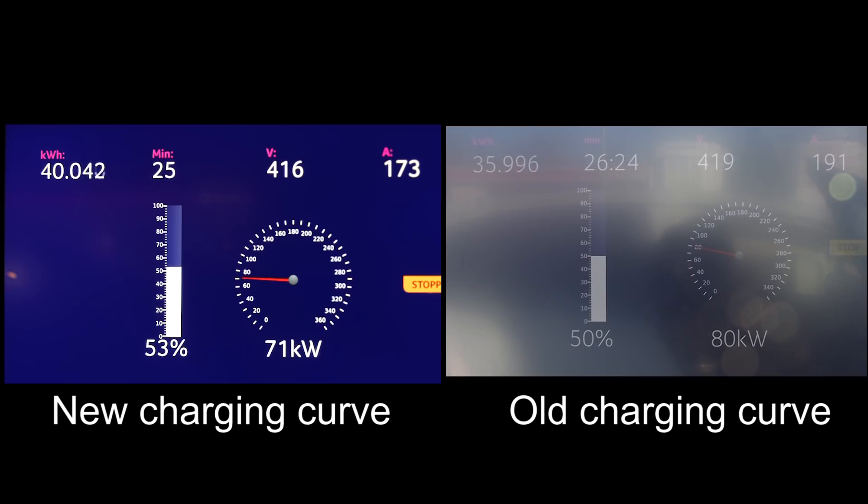So we should try to measure — when I did the 1000-kilometer challenge, I tried to charge to about 60-65%. I calculated that to get there fastest, you actually have to charge between 55 and 65%. Usually what I did was unplug at around 60 or 65%. It's still okay speed — let's say about 60%. 60%, 31 minutes. The old one is right behind it, and it seems like the advantage has been eaten up — you can actually see that the old curve is flatter.